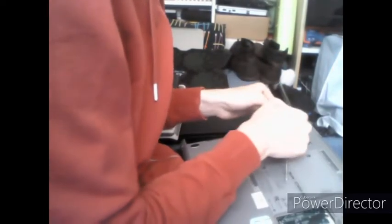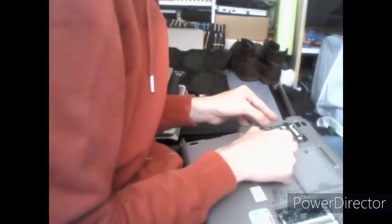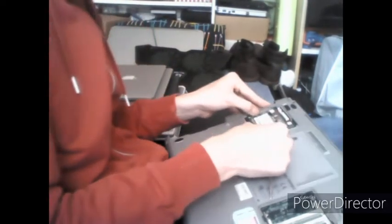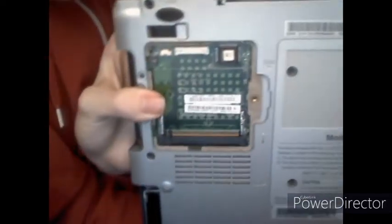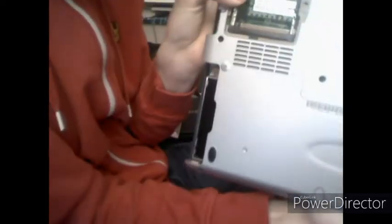Now in there, you'll see a little red and black wire. I believe that's for the dial-up modem. You want to unplug that from the board side, or you can unplug it from the card side, it doesn't really matter. And then just pull the little metal tabs, and then the card will flip up, and then you can remove the wireless NIC. And there's some more information in there. Mine says Matrix on the silkscreen, because that's the model, I think, the RM Matrix 15.